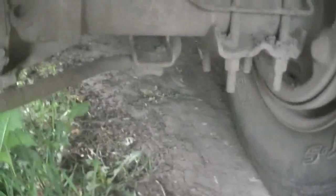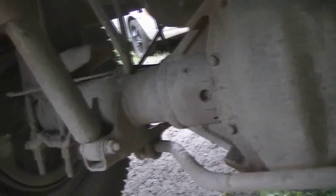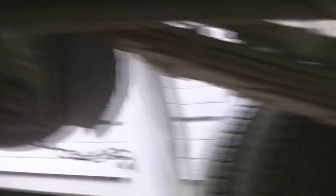I've got to bolt a whole bunch of stuff back up. I'm figuring I'll do a shackle flip and see what I'm riding at. To get these old ones off, I'll just probably torch the rivets out — it's just got four rivets and then the bottom piece there. Hopefully nothing is super seized. But anyways, that's what I've just started today.